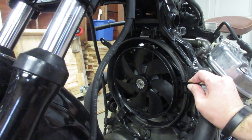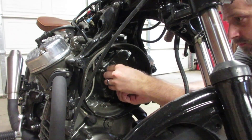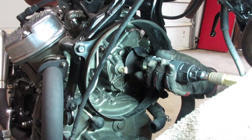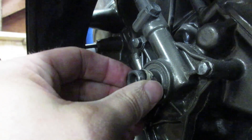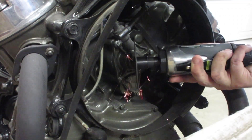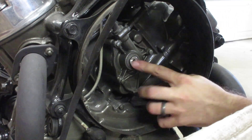The option I'm going with is to just cut back the tapered end so that there's about an eighth of an inch of it extended from the old seal. With the end of the camshaft removed, there's just enough room for the fan to fit, but I want to go back and do a quick bit of smoothing to give me a little more clearance and a good finished end on that camshaft.